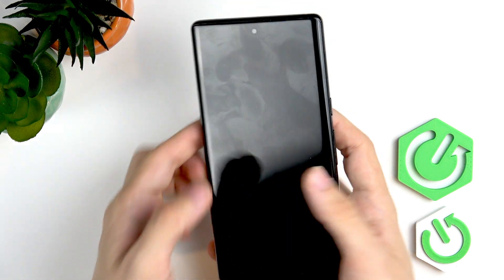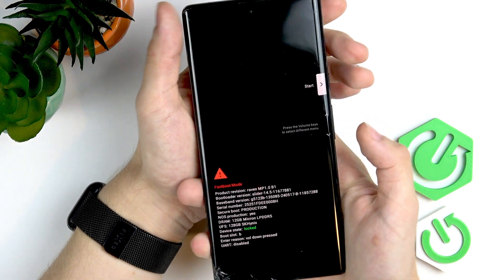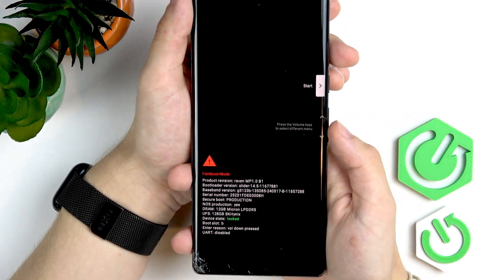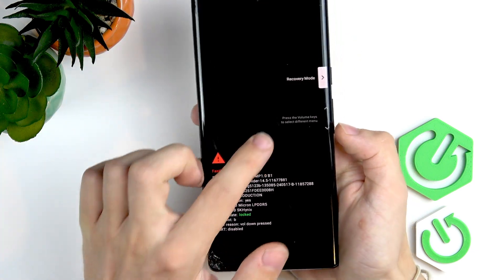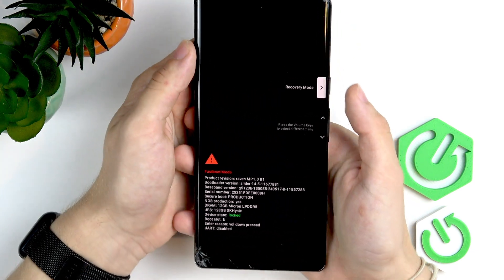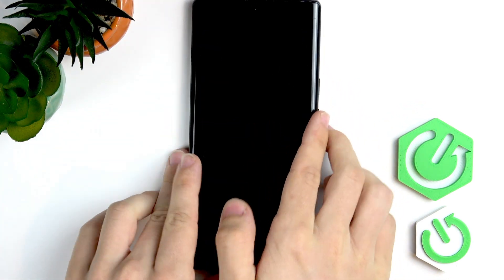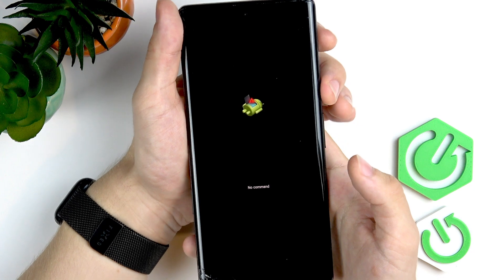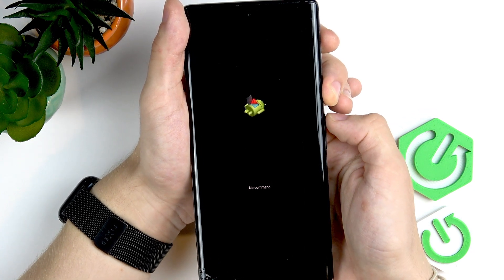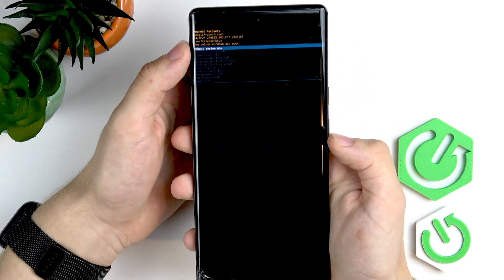After a moment, you'll need to press and hold a combination of buttons — power and volume down — until you see the fast boot mode. It will be quite quick. Use the volume down or up buttons until you see recovery mode. Now click on the power button to enter recovery mode. It will take a moment. Then press and hold power, and while holding it, shortly press on volume up, then release both buttons. You'll see this menu right here.